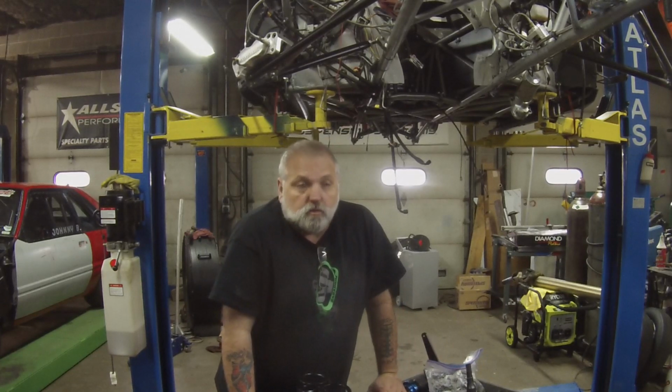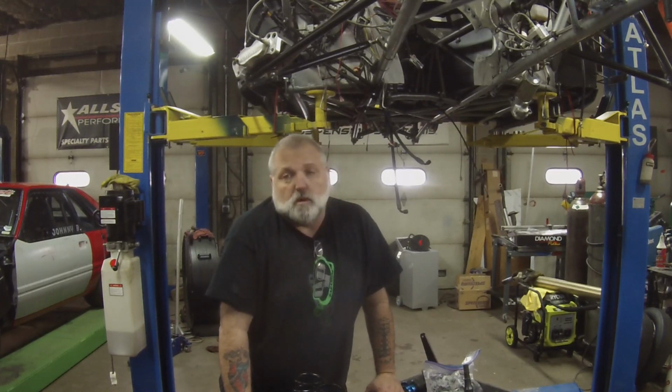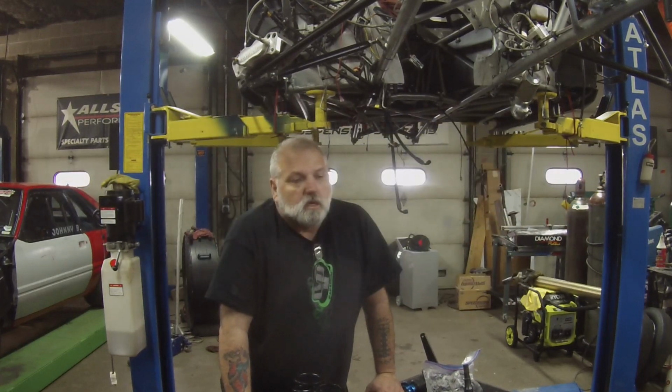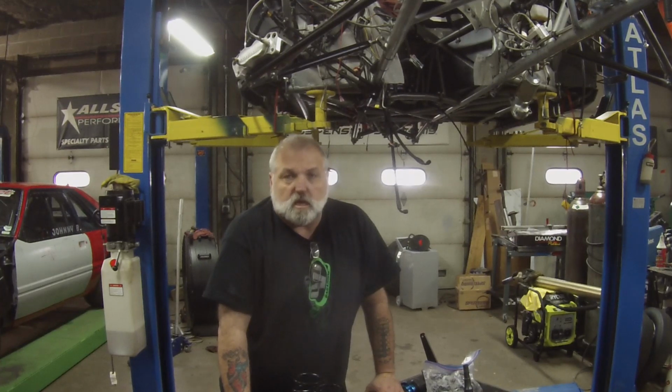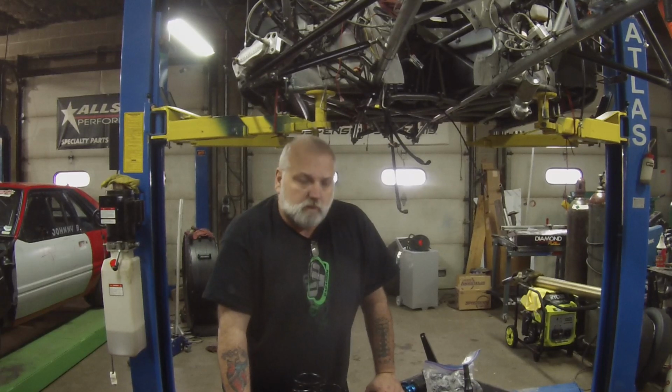Like Greg alluded to, we'll be the first to admit we don't know that much about radial racing. We know the basics behind it, but we've never been on radials before. I made a couple phone calls to people who do know about radial racing, such as Menser Motorsports, for the suspension work. I sent all the shocks and struts in, and they did their magic to it. Their magic basically consists of revalving for a radial tire. They also gave us some different springs. They wanted us to spring the car differently than what we would do on a big tire.